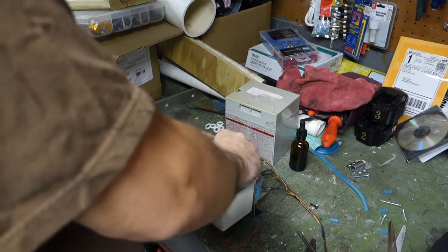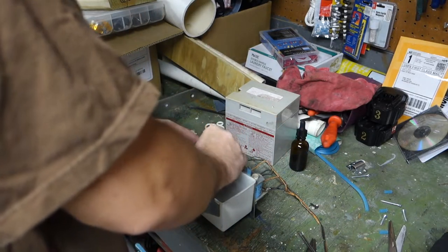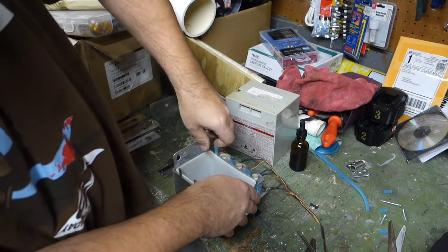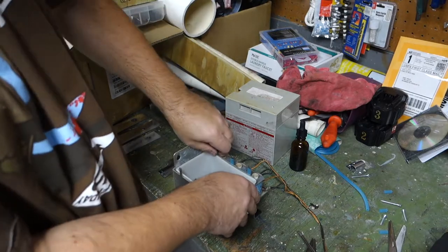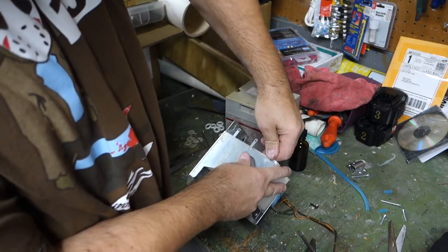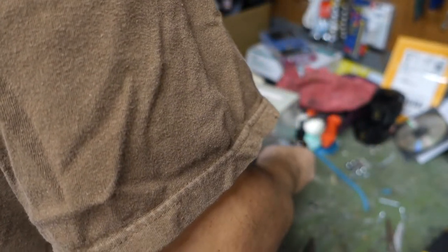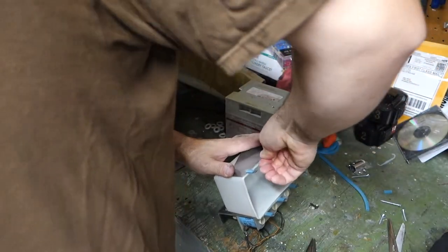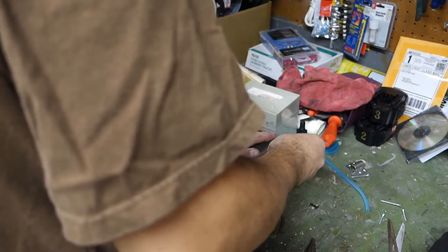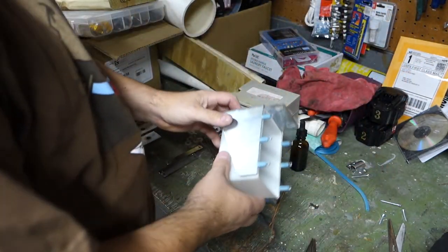They just slide over like that. I use the silicone because it lasts longer, and I feel that the tone bars can ride on it better and get a better resonance to them, because it's not hard like regular fish tank airline hose is, or like the heat shrink tubing that is known to ship with these kits. And it is a good hard press to get these on here, which is good, because you know they're gonna stay snug. All right, those are all pressed on there now.